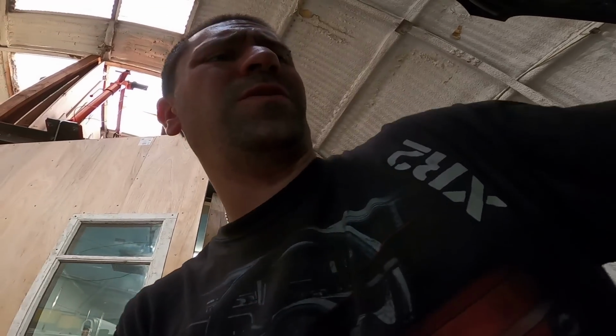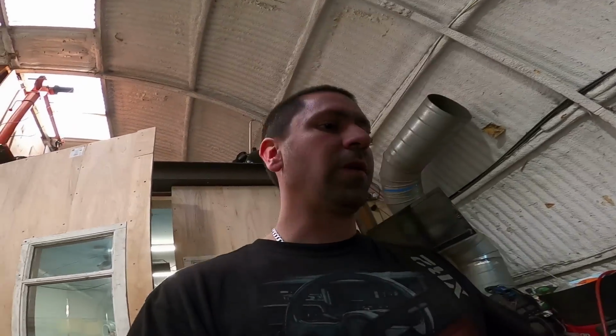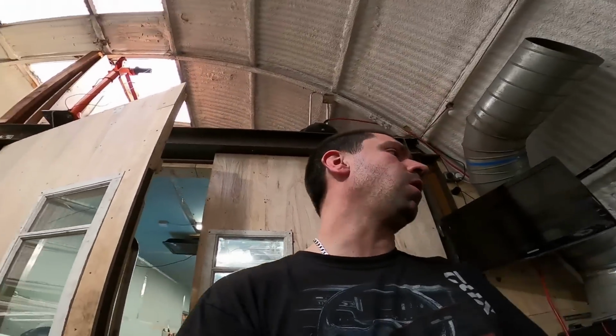I was like, most things run with the MAF unplugged, but they just throw an engine light on. I wonder if it really needs it. Is it that important that it wants the MAF? Because I had the boost pipe off as well, so it's not like the MAF would have read right. Plugged it in, first turn, bang, fired straight up. Didn't even need any easy start. I think, fuck for that. Right, put some coolant in it. Put that boost pipe back on, put the airbox back in properly, and I can run it up to temp.